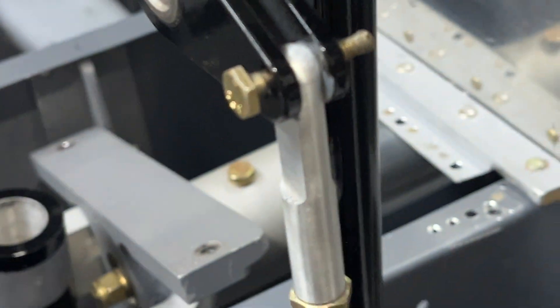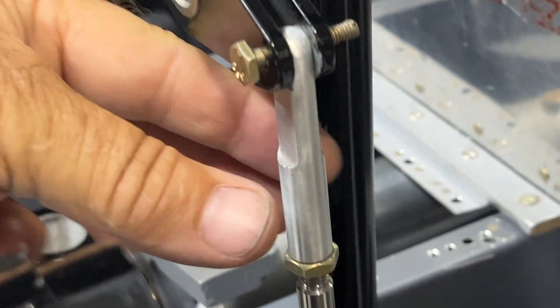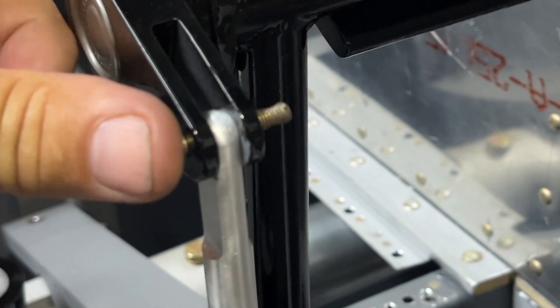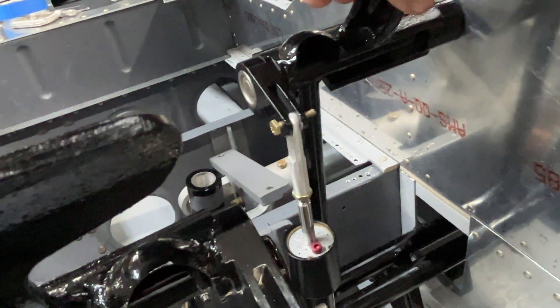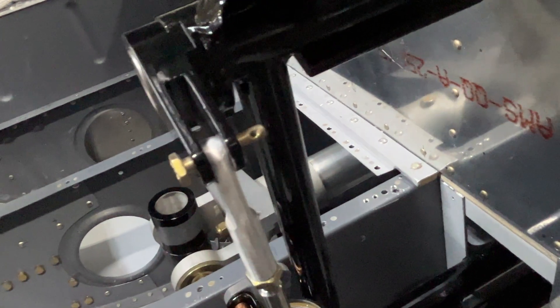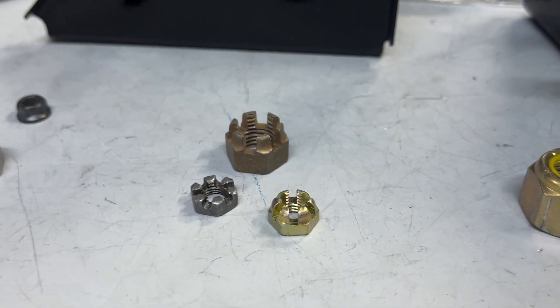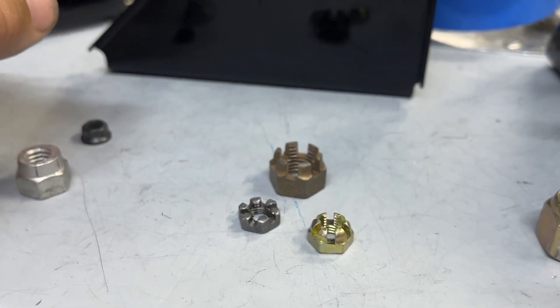Now, whenever the bolt is subject to rotation, let's look over here at the brake pedals. You can see right here on this brake pedal and the master cylinder — there's no rod end bearing in there, it is just an aluminum tube, and a bolt goes through it. As this brake pedal moves up and down, you can see that bolt can be subject to rotation. So what we have to do is use a bolt with a drilled hole in it — you can see that hole right there on that bolt — and then we use what's called a castellated nut. Castellated nuts look like these here.